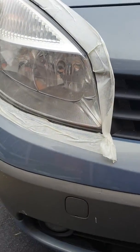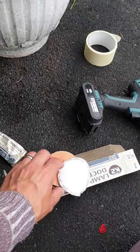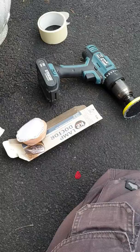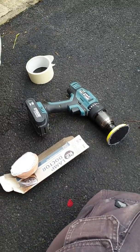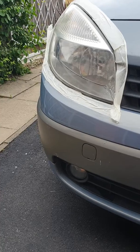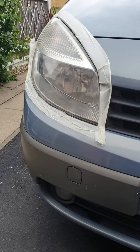I would say if you're going to do this, don't think it's a quick job. In half an hour, the polishing disc has actually come apart because it was getting quite hot — there was actually steam coming off it at one point. It does say on there to be careful about the heat, but you don't seem to get very far unless you've got the speed quite high. The heat being generated actually seems to give you a better polish.